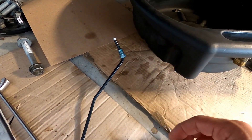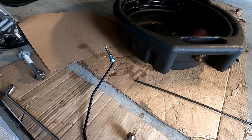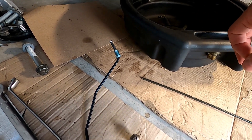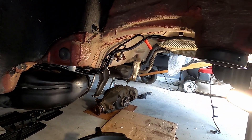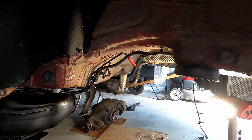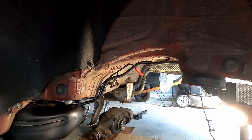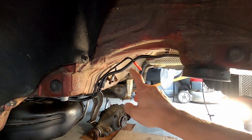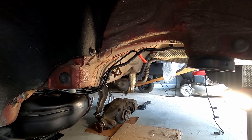So you either have to reuse BMW fittings, or you can ream or drill these nuts out to a slightly bigger diameter, or you can completely get rid of BMW tubing — though you really can't buy it as far as I know. So I came up with an idea: I'm going to try to undo this 90-degree bend, see if I can flare it, and then bend it again. What I don't like about that idea is it's going to be too short, but I'll try to make it work. I don't want to install any extensions — that's no fun.